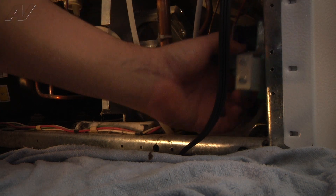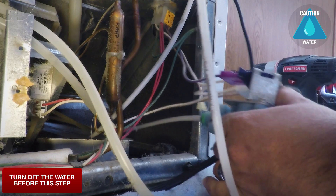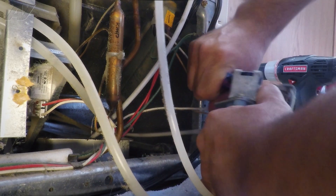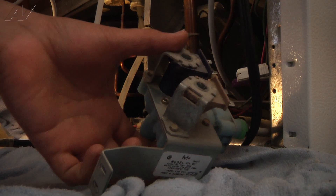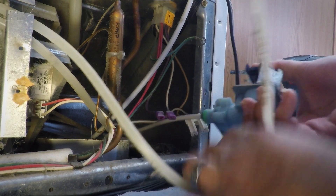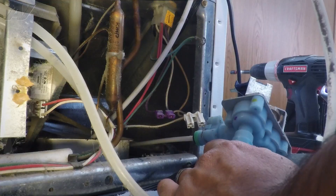We can now pull out the water valve assembly as much as we can. We can now disconnect both connections at the water line by pulling straight off. This water valve assembly does not have compression fittings — it has John Guest fittings. So to remove the water lines from the actual valve, we do have to push in on the John Guest fitting and pull out on the valve. When you do so, whatever remaining residual water that's in the line will spill out, so make sure you have a towel to soak up the water.